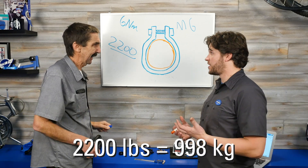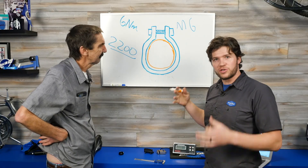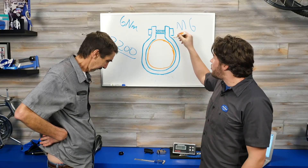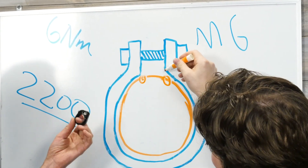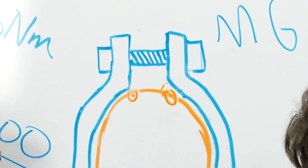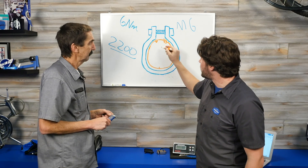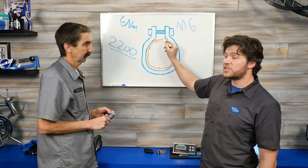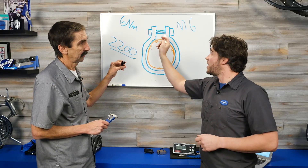That's over a ton of force — but that's in a perfect world, assuming the collar distributes force perfectly. We know that's not so true. The collar point-loads at specific locations because it's being pulled in on both sides. Even if you locate the slot to one side, it still displaces and point-loads the tubing. With three slots, it will point-load that whole section, leaving you loaded more on one side.